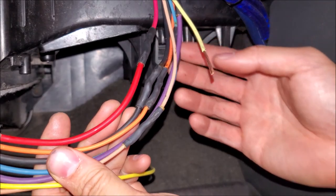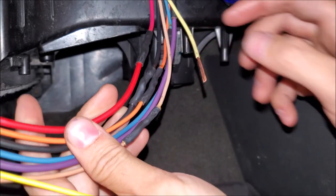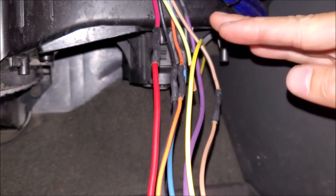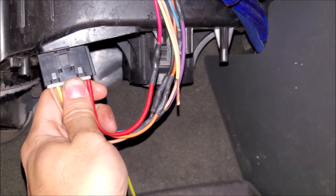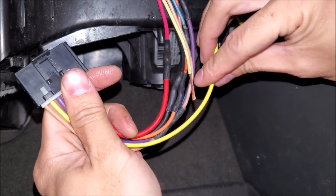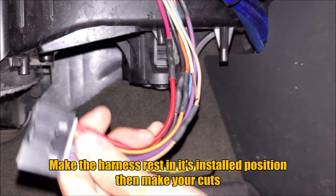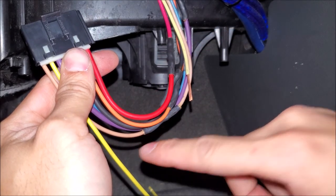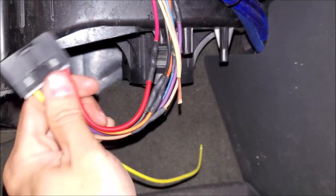What we've done here is stagger cut wherever we can. If a wire is bad, we'll cut further up if there's any corrosion. When stagger cutting, I'm not pulling the wire straight — if you pull it straight, they get different lengths because I know I have to plug in within this general vicinity. As I do my cuts, I do one at a time in position so I know where the cut needs to be. Because if you make all your wires straight and then try to curve them, some are going to be shorter than others — the apex for each wire is in a different spot, so they're actually different lengths.